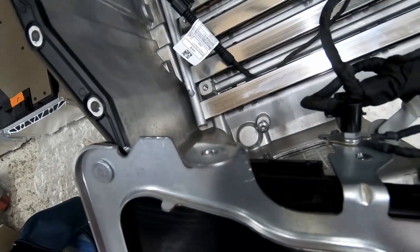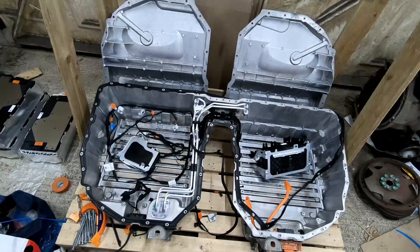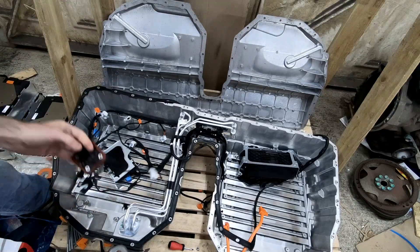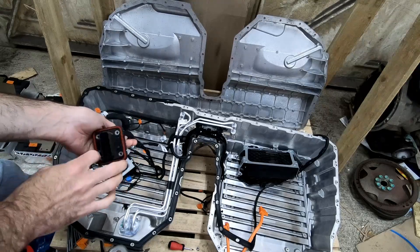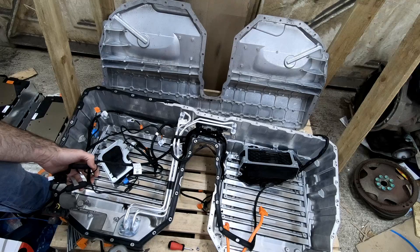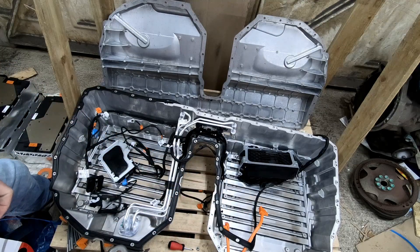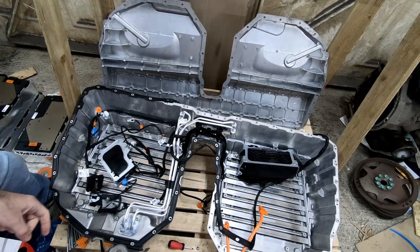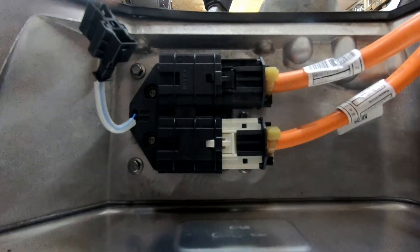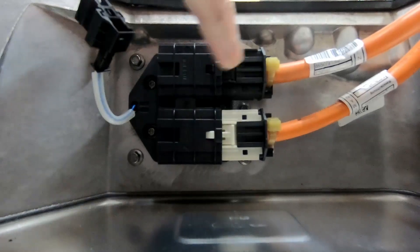It looks like on this rail that connects the BMS to the main body is where the signal grounds are. So that's the wires removed. Got the connector out here — there are four 7mm bolts that hold them in, and I just need to unclip it all from the inside of the unit. I'm going to take the little vent off as well because that will be handy to have, along with the high voltage connector. The vent is another four 7mm bolts, and the high voltage connection is also four 7mm bolts.